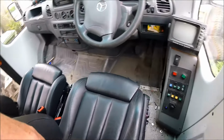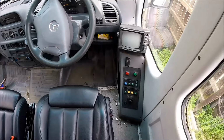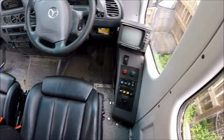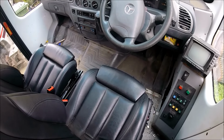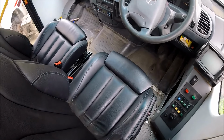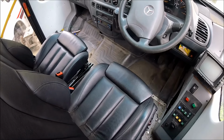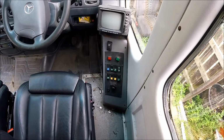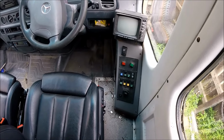And then when you've got it in the position that you want it in, turn the power off, and that will reset the power to the seats. I think these seats have around about a 90 second lockout, something like that. So once you've moved them for your 10-15 seconds movement, you then can't move them again for another 90 seconds or so. So I say fitting a little switch like that, it just means that you can flip the power on and off to the seats as required.